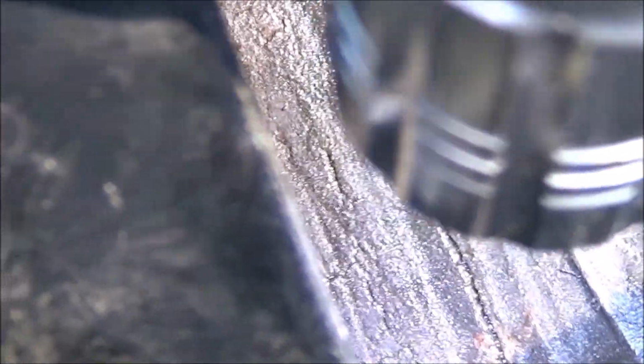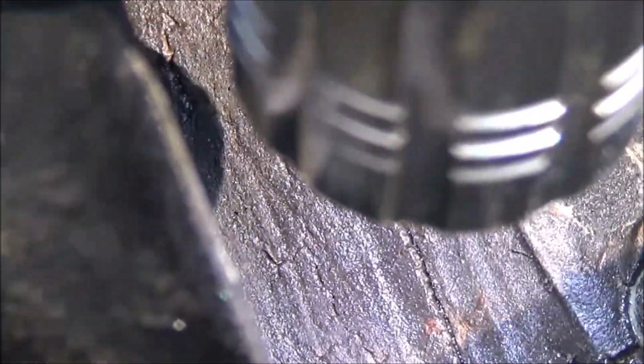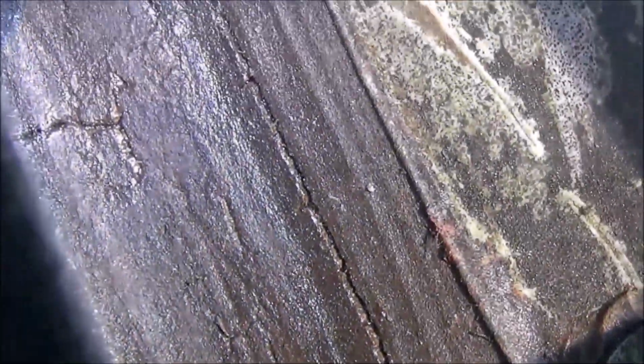Another thing while I was in here that I noticed, if you look, there's a crack on that seal from the factory. It kind of stops or gets really small there, but it's pretty large right there. And I bet that's also letting in some water as well. So probably a good idea to check those out and see if they need to have some new sealant put on them while you're in here cleaning out this fourth one, this fourth drain hole. So I'm gonna do that. I'm gonna dry this up and then put better sealant on it. Some more sealant.